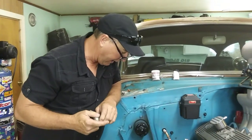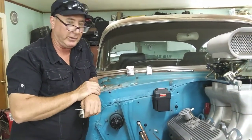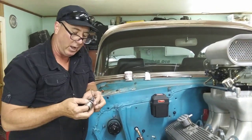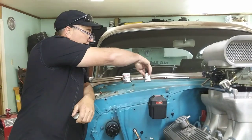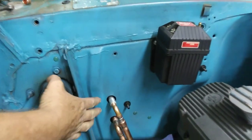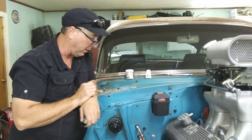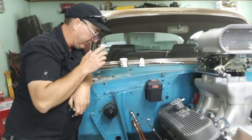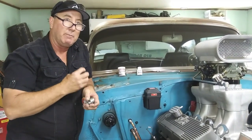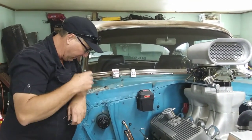We're going to use the typical plumber's soft solder on this joint, but on this aluminum let's talk about aluminum to copper — there are many subjects on that situation. Normally when you're brazing copper to aluminum, it's a difficult joint. You've got to use the correct solder. So we're using the All Solder 500 — you can buy it online, about 20 bucks for a little container. It comes with a secret flux with a little dabber. Cleanliness is the king here. If there's a piece of dirt, the solder will not bond to the metals. You want the copper on the inside of the aluminum — the bonding will actually be a little bit better when the copper is on the inside.